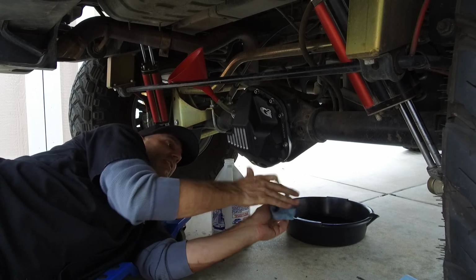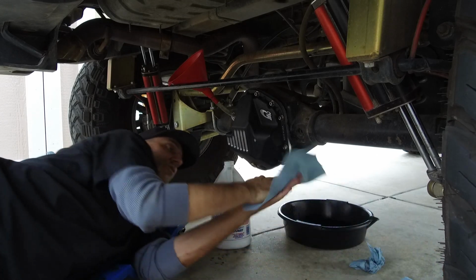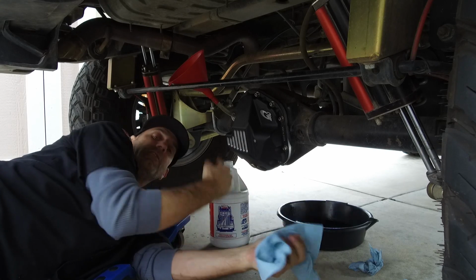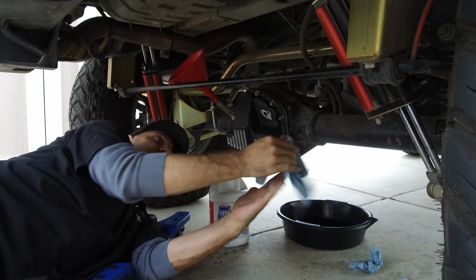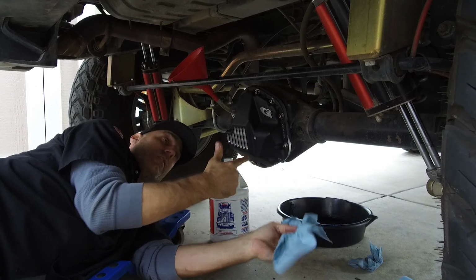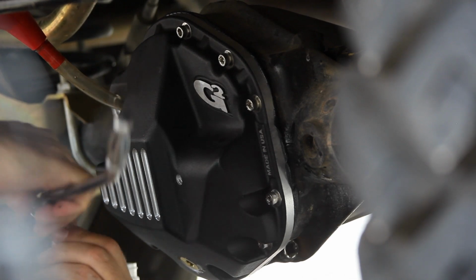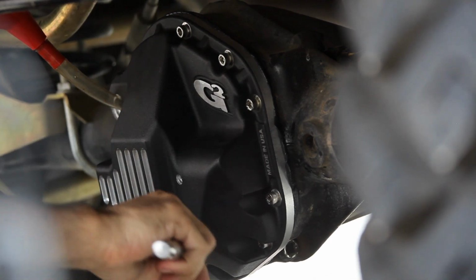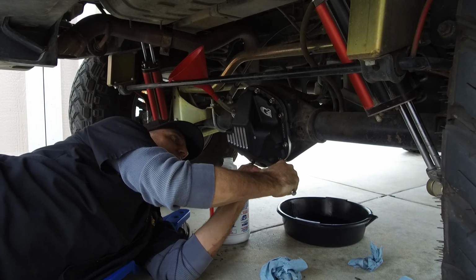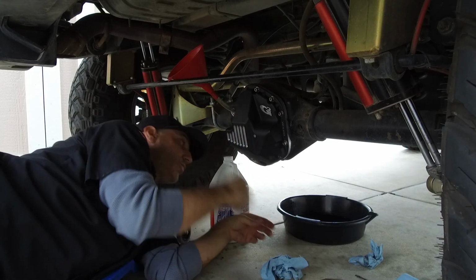It's lasted, and since I drove thousands of miles across this country with it low, here's a good testament to it, to both parts, this stuff and the G2 gears. Now, I put those 4.88 gears in here 2 years ago, and ever since I got the lift, I've been running the diff oil low, and the only thing that I ended up having a problem with was the pinion bearing. And you can't blame that thing, because that just goes tight. You don't want that monster tight. It's got O-rings on it, and that's the whole point of that.